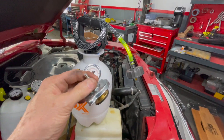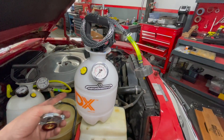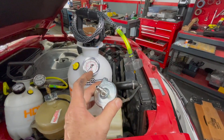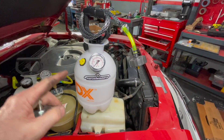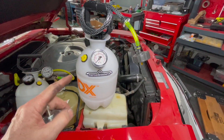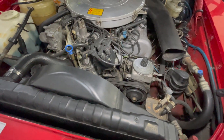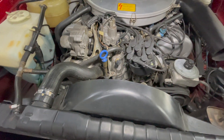As an addition, you can buy the special cap we make to hook onto your radiator or your coolant reservoir to build up pressure in your cooling system. You can move between both uses. Of course, if you're using brake fluid in this, you need to clean it out with alcohol first before you do a pressure test. This pressure tank should be high on your list of things to have in your own shop. Anytime you work on your cooling system — whether replacing a water pump or a hose — you want to test the pressure before you drive it down the road.